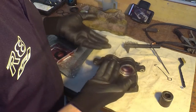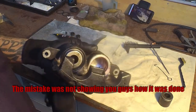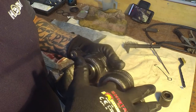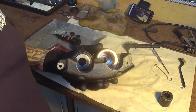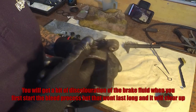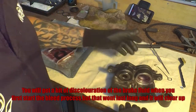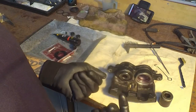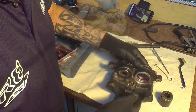Now I'll go through the process of putting them together. I got my rubber grease and coated the inside of the caliper bore - it helps protect against wear and corrosion and will not affect the brake fluid at all, it's only a very thin layer. I got the square cut seal, put grease all over my fingers and ran them all the way around it so it was fully covered, then got as much as I could into the outer lip where the dust boot will sit.